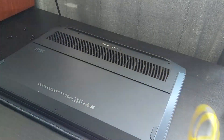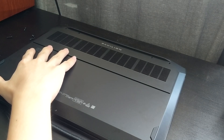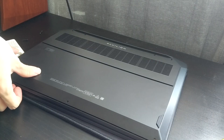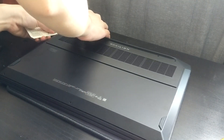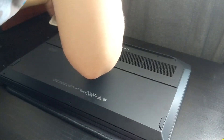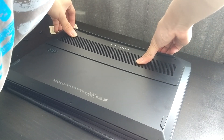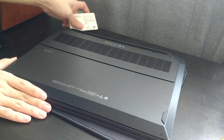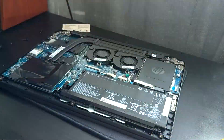Now I'm going to show you how to change the hard drive or access the RAM by removing the back panel. It's a pretty simple process — there are no hidden screws, just unscrew every screw visible on the back panel. Once done, find a corner and use your fingernails or a credit card to slide along the edge. You'll hear clicking sounds as the clips unclip. Then gently pull the back panel out — don't use too much force or you'll risk breaking it.